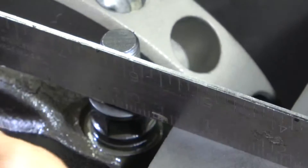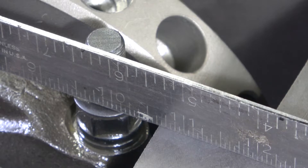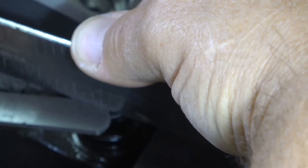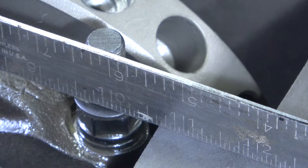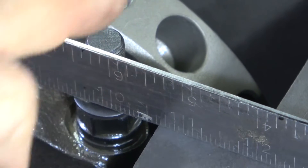I find it's easiest to lay your shims out right next to where you're working so you can pick them up one at a time. I'll start with a 23, 24, and 25. You've got to be careful not to drop it inside the engine. The washer may rock, so you might want to hold on to the back to make sure it doesn't. This combination is just too big, so I'm going to exchange the 25 for a 22 — that reduces the shim pack by one thousandth and it just about fits. So adding those together: 22 + 23 + 24 comes out to 69. What a coincidence — this is a 69 block. I just write 69 right next to the stud on the oil pan rail so I know how big the shim pack needs to be on this particular stud.